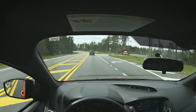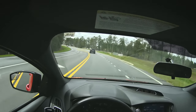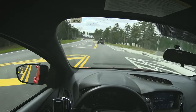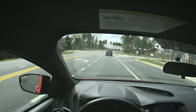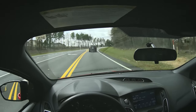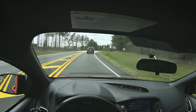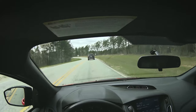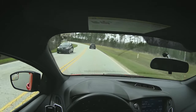This clutch does have a natural strong kickback — it depends on what car you're coming from. You still get a little bit of that kickback; it's not as linear as it could be, but it's much better with the spring. I did try it without the spring — it was the most linear — but you don't want no spring at all because your clutch won't return all the way to the top.